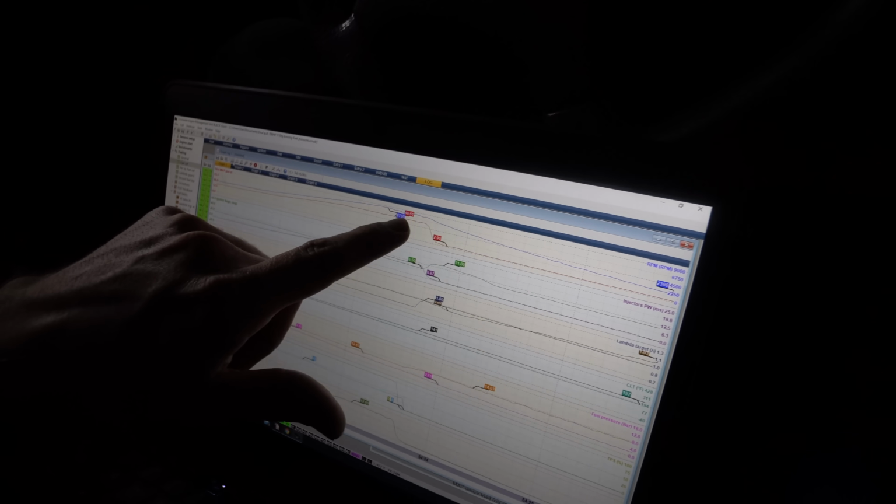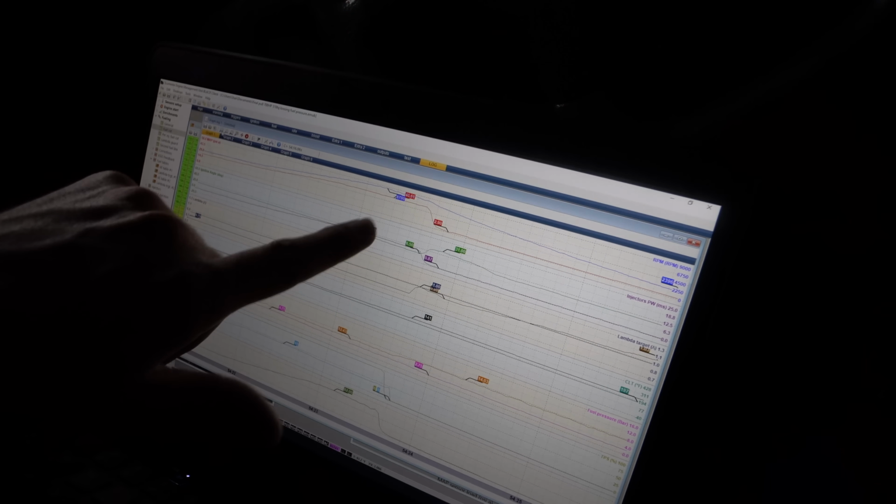What's happening is it's dropping from like 4.7 bar to like 3 something. So we're losing a little over a bar of fuel pressure, and it's taking the air fuel from like 11.3-ish to about 12 as we're doing a pull. And that's just in the higher boost levels. You can see right here, that's basically 40 PSI, and you have to take away atmospheric, so we can call that like 26 pounds of boost at 8,700 RPM.